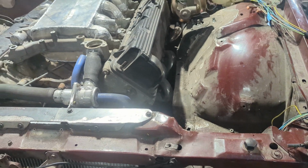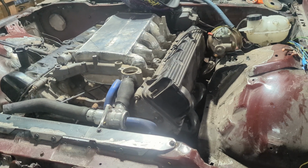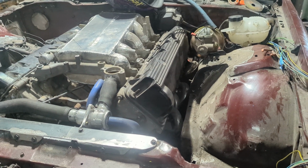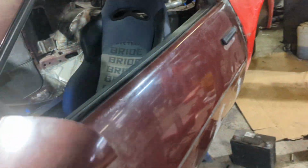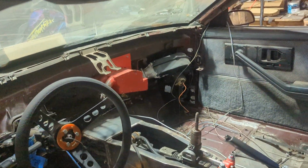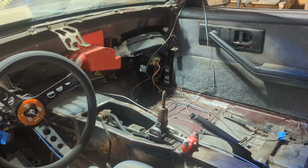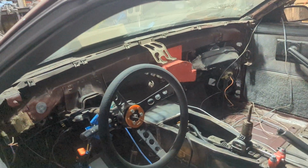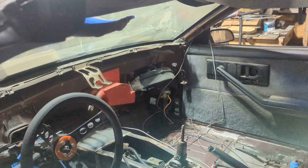So now we're going to probably mess around with the throttle linkage, and once we get that in place, we can maybe go back to the wiring side of it. Not a fun part, but I mean, we got somewhere that I've completely forgotten now. But yeah, we've got our little switched 12 volt and constant 12 volt posts there that go from there, and then they go back here as well. And then we've got the fuse panels, and a couple of 50 amp circuit breakers that are going to go in the engine bay area.